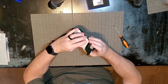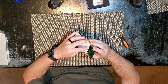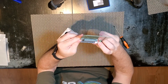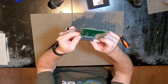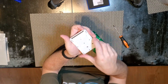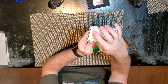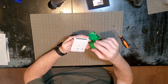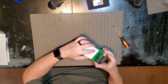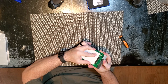Interesting — this is a little tight. I don't know if this is going to work or not. If it doesn't, I can de-solder the header that we're plugging into here on this board and raise it up a little bit. The problem — I don't know how well you're going to be able to see this on video — is that this header is soldered flush to the board, which works fine if the pins are all the way down. But on this adapter, these pins may stick up a little bit. It's through-hole soldered here for strength rather than surface mount, and that makes it not completely flush. The combination of the two makes this a little more challenging.